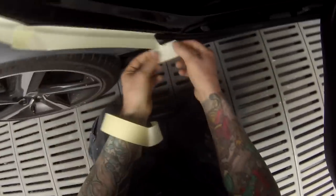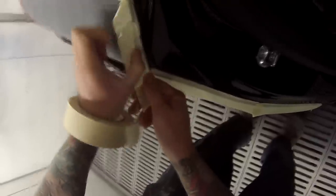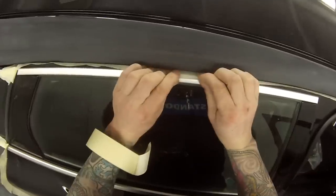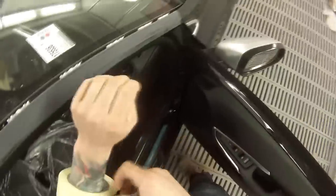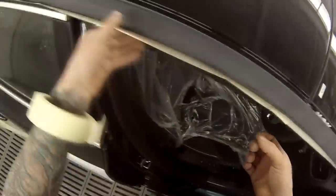It's a 3M trim masking tape we'll be using on the rest of it. I've found this is all that's necessary — if you're just doing the quarter panel, simply back mask it and pull it up nicely. As long as it's not a big sharp edge, just peel it back just a touch off the edge, and when you're painting don't load the paint on too heavy on these edges — 99% of the time it works fine. You may find you want to do a false edge and then back mask over that, which I used to do and got good results, but I've found it just wasn't necessary.